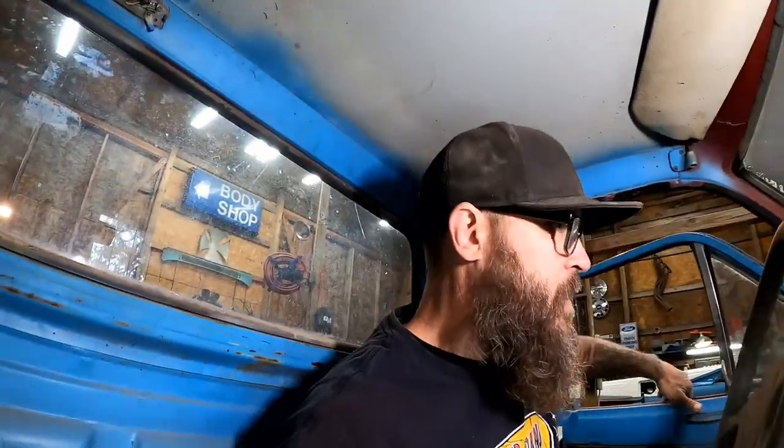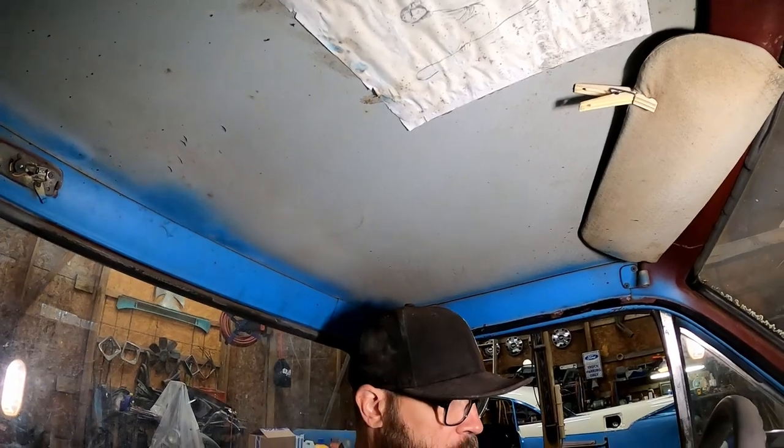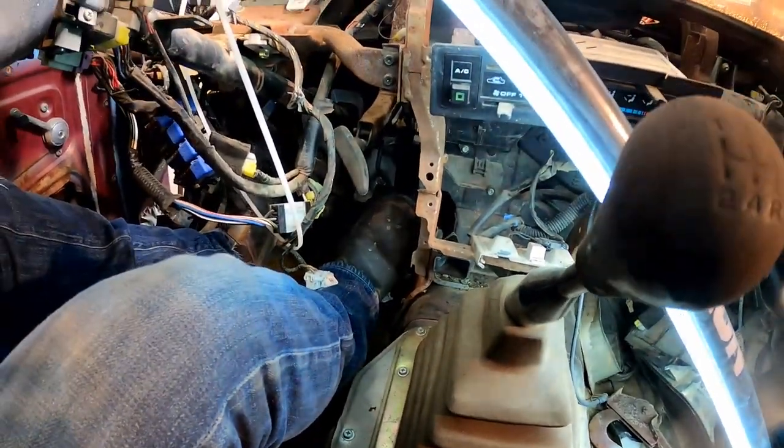I have designed and redesigned this thing a hundred times in my head, and a lot of it is because you run into little things along the way that you don't know until you run into them. One of those things is headroom — there's just not a lot going on there. There's absolutely no way to run the factory-style seats from that Nissan Hardbody, which I actually have sitting over there. It sits up too high — my whole head is crammed against the roof. But this cool little boat seat in here seems to be working perfectly, sitting right on the floor. I've got plenty of headroom and plenty of leg room. This actually feels really comfortable and like it's going to be a lot of fun to drive — everything's just right except the steering wheel. That column's definitely going to have to get shortened.